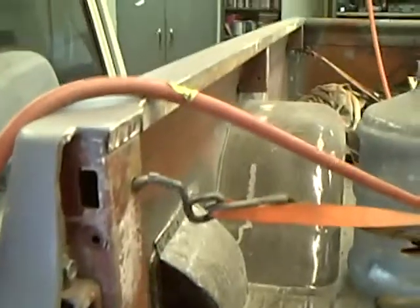I'm working on the latches and the handle and stuff, because the tailgate didn't come with the new ones. This tailgate was made by OER — it's actually a pretty good tailgate. It holds the lines and stuff pretty good, fit right in there. The only adjustment I had to make was on these tabs that go in those holes — I had to hammer them a little bit until they just slipped in. Once I get these latches sorted I'll have my tailgate done. Thanks for watching.